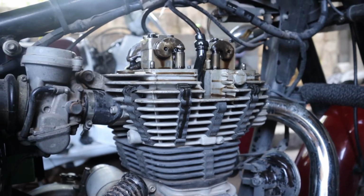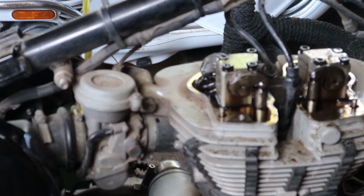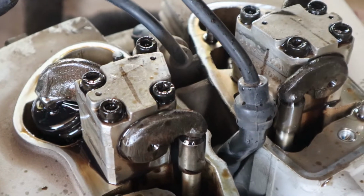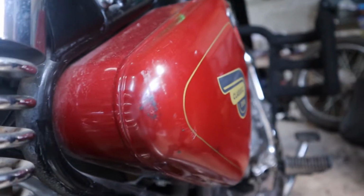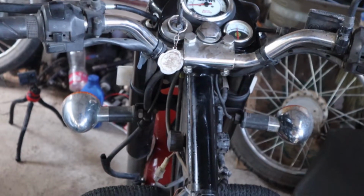See, as we can see here, the oil flow is lesser than normal near the push rods, which is the topmost position in the oil flow circuit. Since the oil flow got reduced, we have to check for the reasons for the reduction in oil flow, plus we need to check for any damage in the associated components.